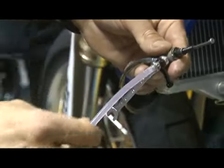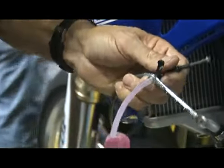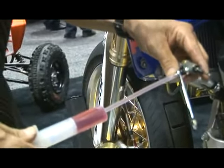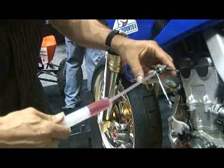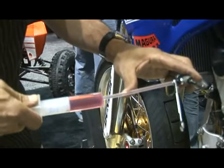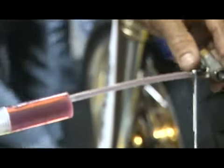It's as simple as pressing the tubing on the nipple and cracking open the bleed nipple itself. The procedure you'll want to start with is a pull, just to remove any air that may be residing in this assembly. You can see the air is pulling out now — I'm able to just pull on the syringe and create a little bit of vacuum and pull that air right out. I have enough fluid in the master cylinder to where I will not suck it dry.